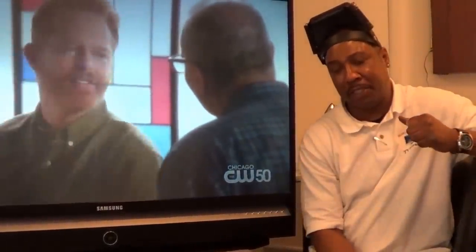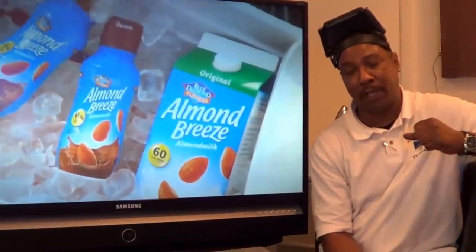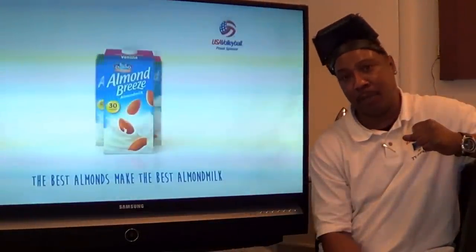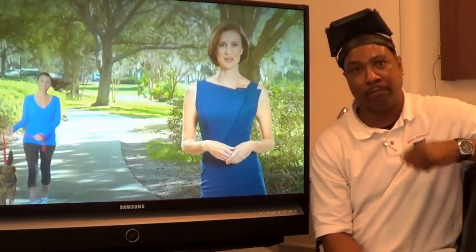The Mitsubishi 73-inch DLPs are very nice sets. When you change the lamp, you definitely have to clean those fans — I've had times I put a lamp in and it lasted two weeks. That's how I found out the fans have to be clean whenever you change the lamp. I hope you enjoyed the video. If you have any comments or questions, please comment below, give me a thumbs up, and I'll see you in the next one.